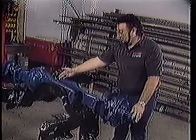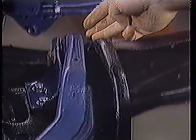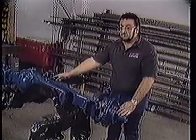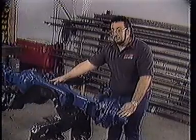As you can see, the kingpin axis is traveling in this direction. What that does is on this bushing here, this bushing now goes through a torsional movement. What we tried to do here at Rancho was eliminate some of the movement, which would eliminate stress, which would thus give us more wheel travel and a smoother ride.